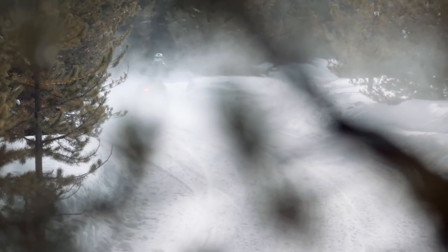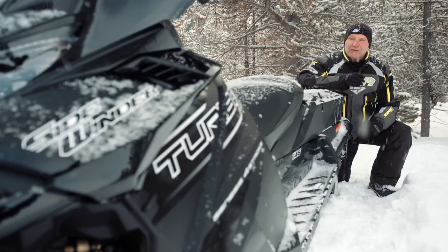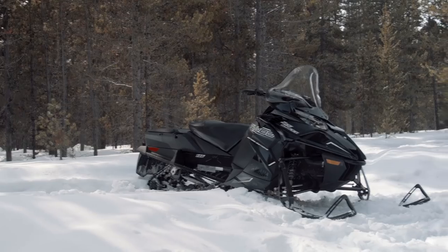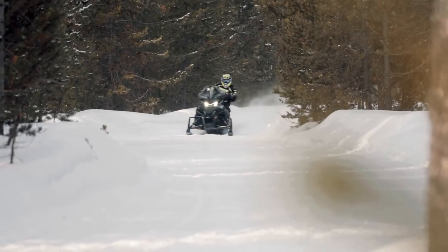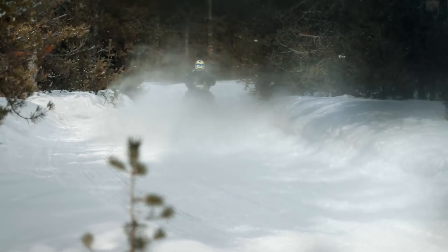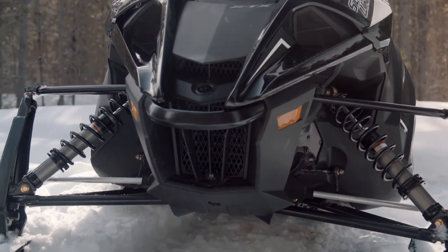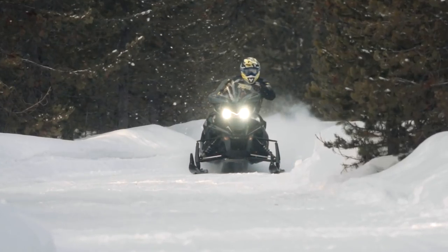The STX handles every bit as good as Yamaha's 137-inch rides on twisty trails. The 146-inch track out back is as transparent as a glad sandwich bag — there is literally no hint of push or understeer in twisty terrain. This is a remarkable accomplishment considering 146-inch sleds pretty much all display a measure of track edge induced understeer. The relatively low 1.25-lug Rip Saw 2 out back allows the capable wide-spaced A-arm front end to pivot the chassis with confidence-inspiring control in the tightest trails.